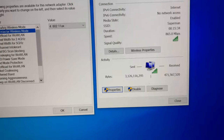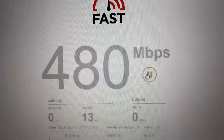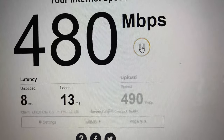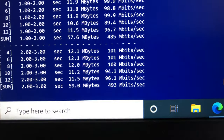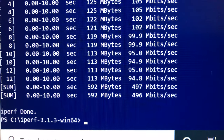Switching to the laptop with the Wi-Fi 6 card at the same 30-foot location, we still have a very good wireless connection. Using fast.com we're getting 480 Mbps download and 380 Mbps upload wireless speed. Using iPerf 3 five-stream test on the laptop, we achieve 497 Mbps bandwidth speed.